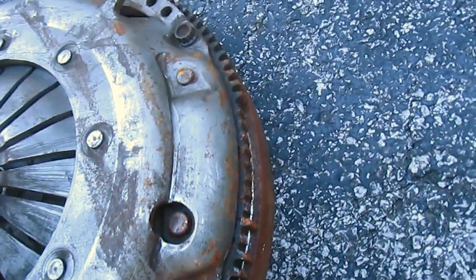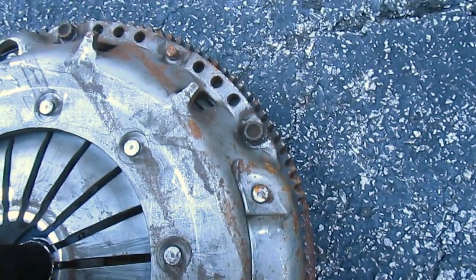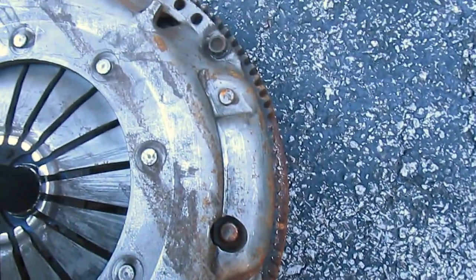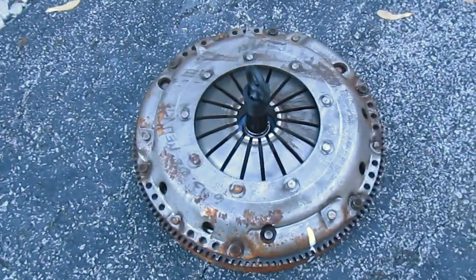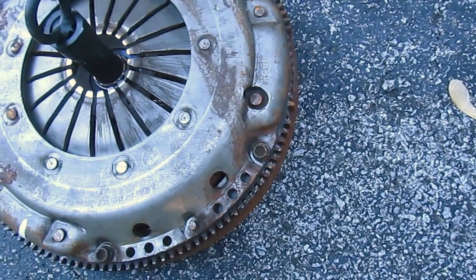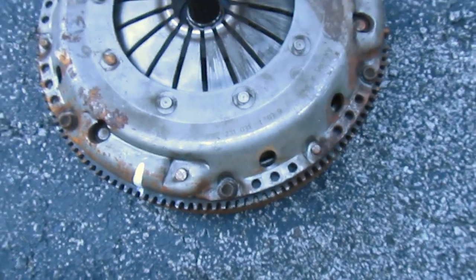See what happened here — this is what happens when you try to start a car that is hydraulically locked with oil in the cylinders. I wound up turning that engine over by hand, which really wasn't a good thing to do, but it was the most efficient way to get the oil out without disassembling the engine. What happens is you try to start the car and the starter is extremely powerful — it just starts snapping off those teeth like corn.